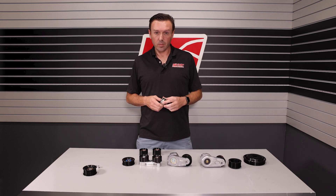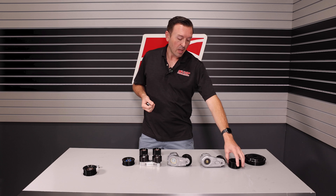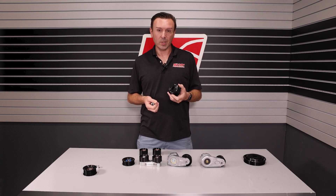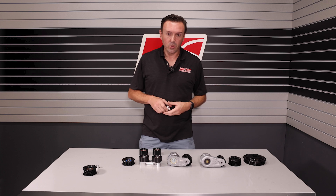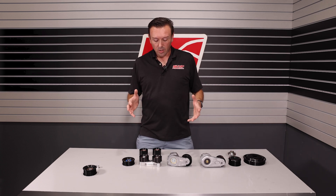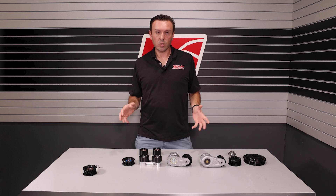One other thing I want to point out: if you're using this on a Predator blower swap, it has a wacky clutch style pulley. We do make a hub and bolt-on style pulleys. These bolt-on style pulleys allow you to dial boost up or down from a three-six, which is about nine PSI, all the way down to a two-four, which is like 20 plus PSI. When you do go to the smaller sizes, you need to use a grip textile belt, which we do sell on our website. This all works great with the stock Predator eight rib balancer, and as aftermarket options become available, we can talk more about that.